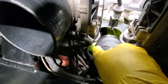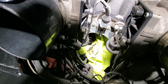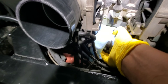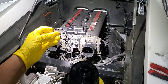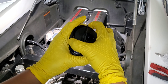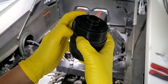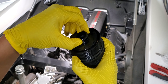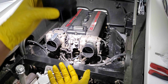It looks like my filter decided to stay in there as the filter housing came out just fine. I have an extra rag with me to pull out the filter element, just like so. The old O-ring is on the right, the new one's on the left. You want to make sure you put oil on the new O-ring right before you install it so it doesn't get pinched and split during the install of the oil filter housing. There's also an O-ring right here — you also want to make sure that has oil on it as well so that it's a smooth installation and doesn't get bound up. The oil filter just clips in there — press it in, you'll feel it pop and click in place, and then you're good to go and install it.